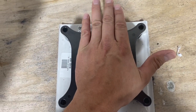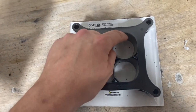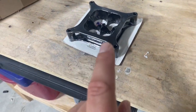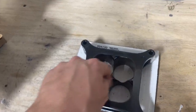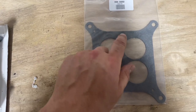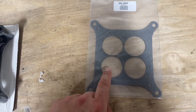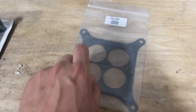So I spoke to Holley and this is what they said I should do. Currently on the truck I have an open element, just a rectangular hole, one and a half inch tall spacer. This adds plenum volume, which can be beneficial, but it does not do anything to help the noise. After speaking with Holley, I learned that what you want is a four-hole spacer, and this will correct that annoying sound. There are kits out there where you can buy a small thin plate with gaskets on each side that allow you to install a four-hole spacer directly on top of your intake — you don't need an expensive Wilson Racing taper bore spacer to correct the sound. You can do it with just a standard four-hole spacer.